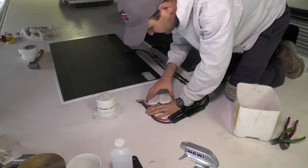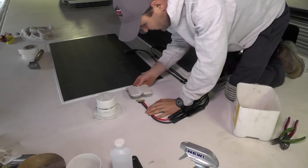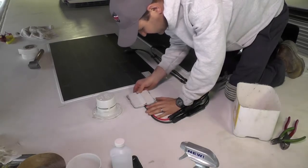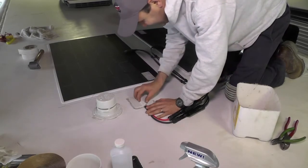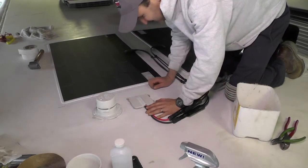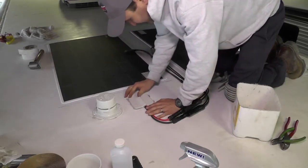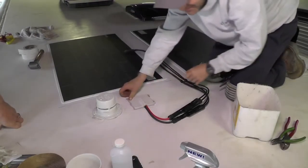And so we have the clamshell, which we've applied butyl tape to the bottom of. And this clamshell is made by Winegard. There's a couple of other ones out there, but these are available online for sure, or from your RV supplier. And you'll see this is a dual cable model, so it will accept 2 wires in the spacing.